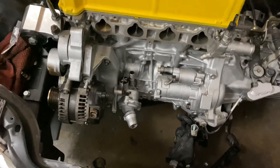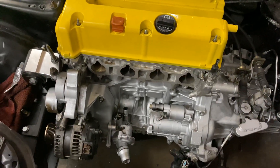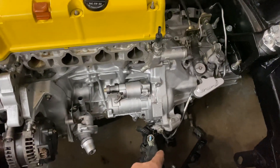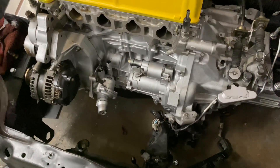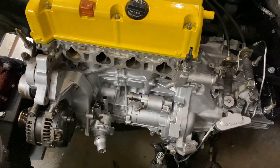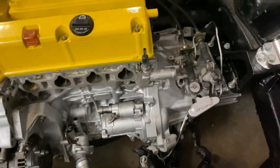I got the clips on and it does shift properly now, even though it's not fully bolted to the floor yet. The alternator's on. I'm debating whether to buy the swivel thermostat — it's about $26 for a cheap one. I could buy a hose and loop it back to the radiator and it would work, just look ugly. I'll probably buy the swivel thermostat, but I'm trying to keep the total expenditures for the swap down.